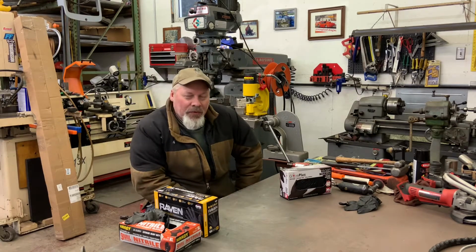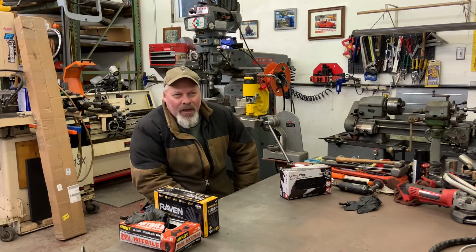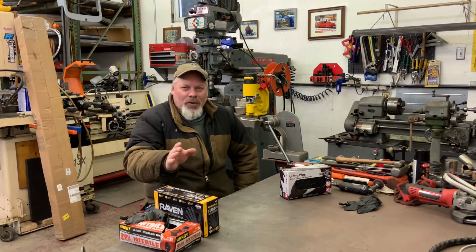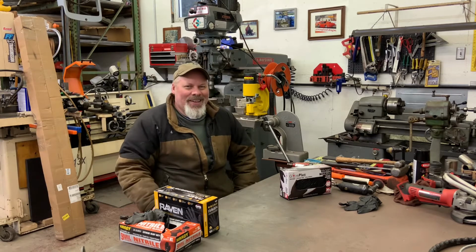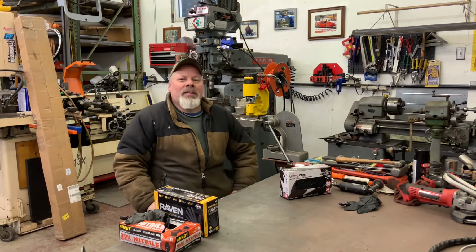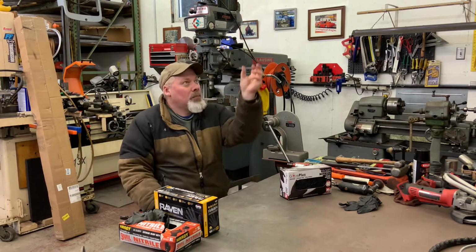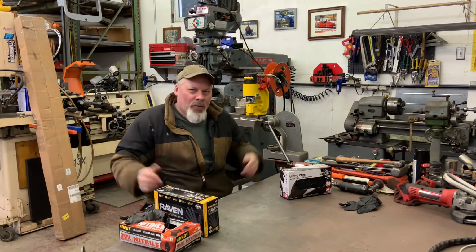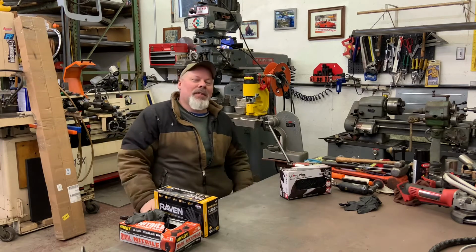I need to finish up the rear end work in the Dart. Where I left it, after I put the wheels on the other day, my '64 Dodge Dart GT LS Turbo Powerglide 9-inch Ford project. Sounds like a commercial. I've got the rear end centered again after I put the new wheels in it. I found another block of wood that fits perfectly between the tire and the inner frame rail on both sides. I moved the rear end back and forth till the block of wood fit. No more scientific than that.